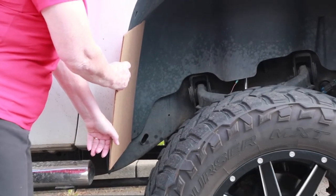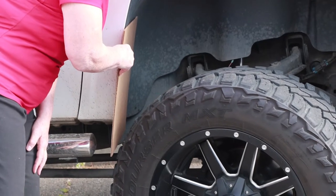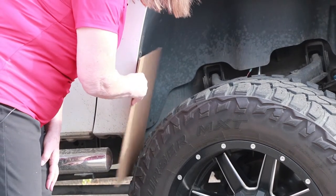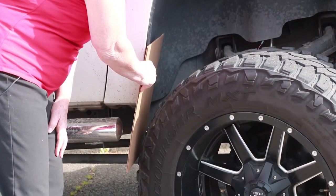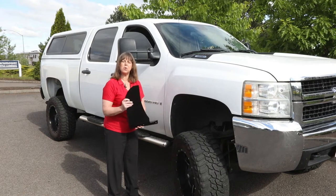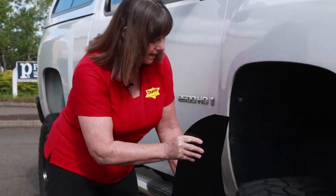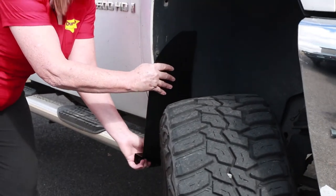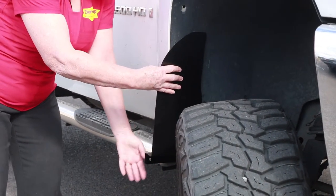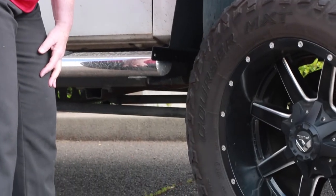Obviously turning away you don't have a rub issue. Now let's turn toward yourself toward the side — and there you see you do have a rub issue where that tire, especially down low at the widest point, is going to be rubbing the mud flap if it hangs straight down inside the fender well. This truck will actually require our LFT setback bracket, a stainless steel bracket that goes inside the fender well, stops just below the fender well with a 90 degree bend, and then you'll hang the mud flap at the bottom of the bracket. That'll set it back so that it won't be rubbed by your tires.